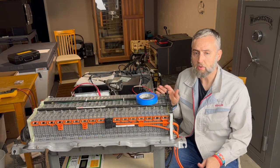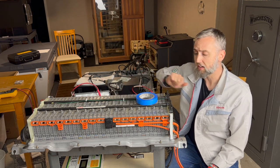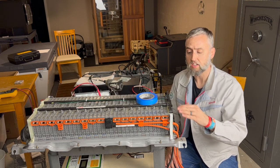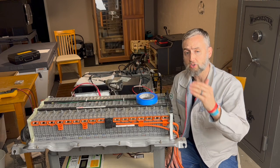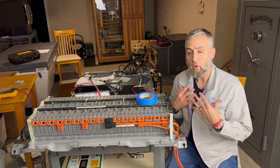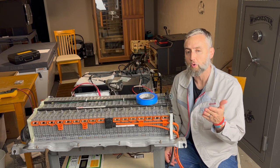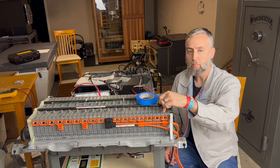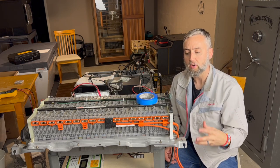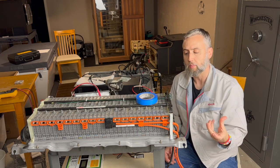So we've got the battery completely reconditioned at this point. I'm going to be reassembling the battery, getting everything back together, but everything has been reconditioned. What that process is, it's a charge, a discharge, a charge, a discharge, a charge, a discharge, and then a final charge and balance. What I do for maximum results is every time I charge, I let that charger go for an additional 4 to 6 hours to help balance the modules, to really get them exercised up to their highest point to where they'll break dendrite formation inside each of the cells and help restore lost capacity.